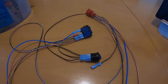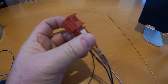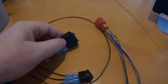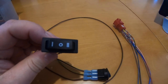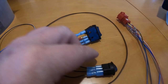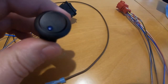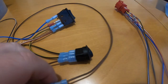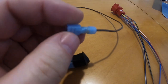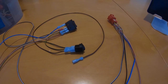The cruise control wiring is now loomed up. It's a four pin plug which goes into the connector underneath the dashboard. That's the momentary switch for set and resume, faster and slower. And then the on/off switch so I can disable it, and then the ground which goes to the ground point on the steering column. Now just to install it properly in the van.